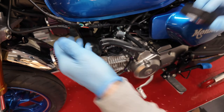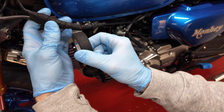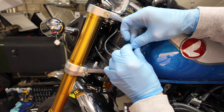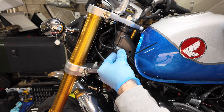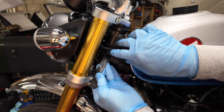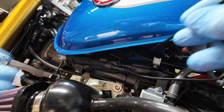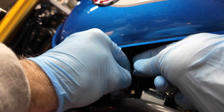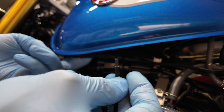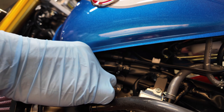Depending on your bike, start to tidy up the cables — I like to use fabric loom tape and the odd cable tie. If you route wires along an existing route, just check they don't get pinched when you turn the handlebars. The instructions say not to route them with existing wires as it could cause interference, however I've never had an issue. Once you're happy with the routing, take some cable ties and secure everything back.